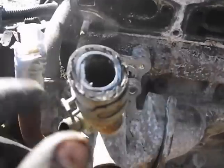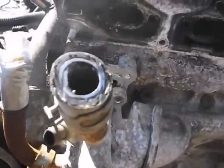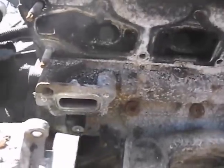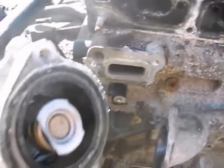Do not cut the hose like I did — remove the clips. Lift up the hoses and then move this out of the way. You're going to have to be gentle where that stem comes up. Remove it out of the way, and this is the perfect opportunity to change the thermostat.